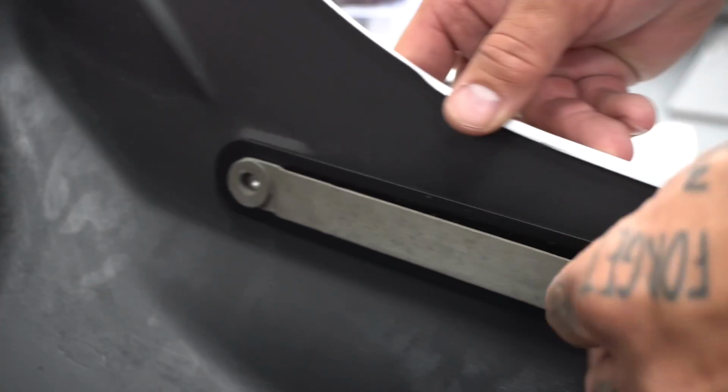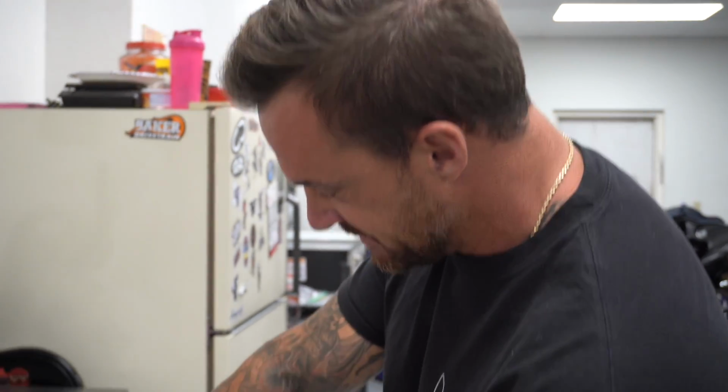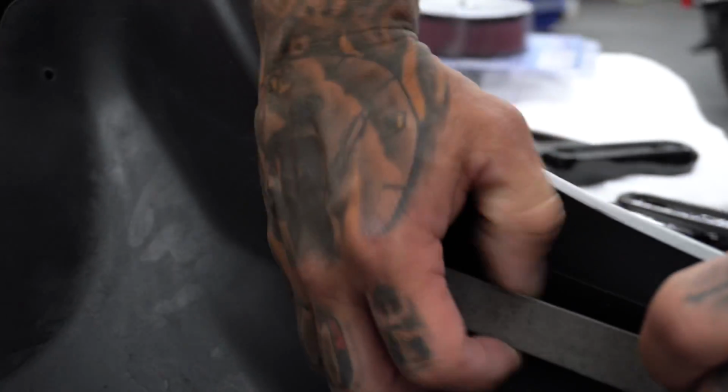One super tech tip of the day, and you're putting a soft tail fender on. Definitely 100% easier to assemble the rails and all that this way before you put it on the bike, because there's a bolt that goes inside here. It is a bitch to get to otherwise.